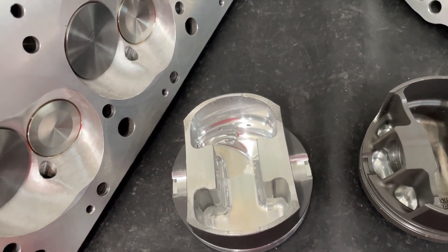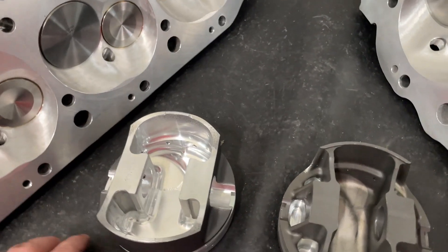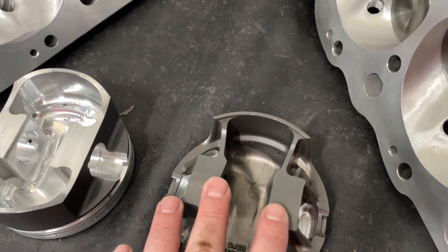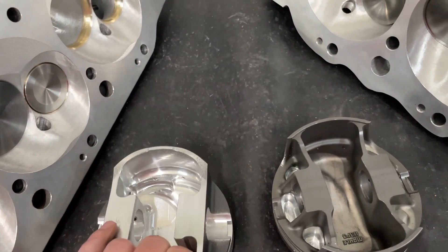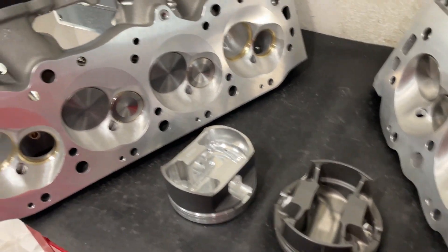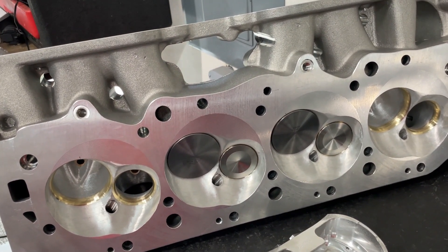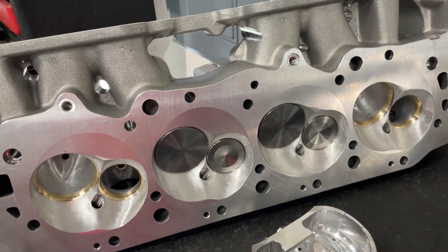You can order them the traditional way, I just didn't — because it's going to get insanely expensive for a pump gas deal. This will be more than adequate for what he's doing, and this design will probably work for engines making easily over 1,200 horsepower. I just prefer this design because it keeps the weight down and the piston itself usually weighs less. For those wondering if this head is too big for a 582 pump gas deal — it is on the larger side. But I'm also doing the camshaft for it, and the duration is nothing. It's going to rev well, and this thing should be really, really nice. He wanted 900 horsepower — easily going to hit his goal.